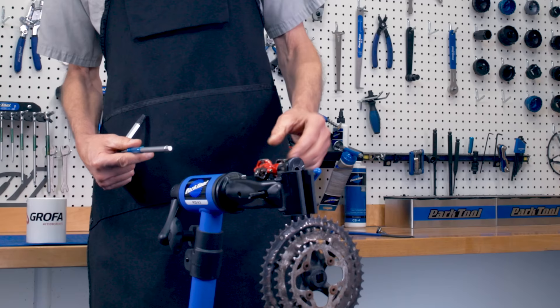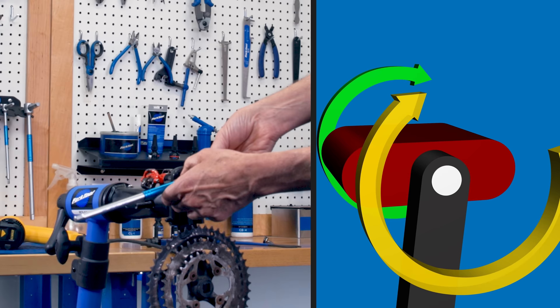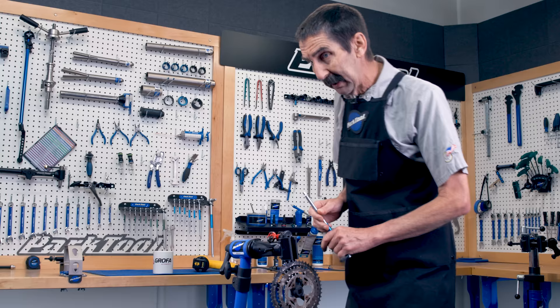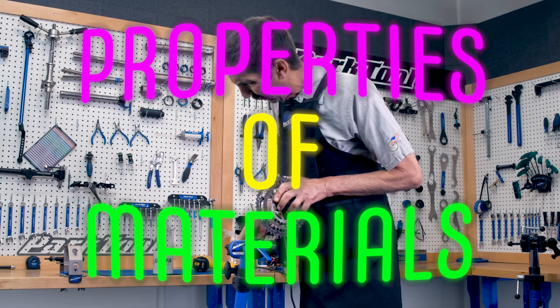Let's talk about direction of turning. This is a pedal and I'm on the drive side — this is a right-hand thread. On the right side I'm going to go counterclockwise. See that motion? Counterclockwise. But the wrench is from the backside of the bolt; the wrench direction is still the same. You're seeing it — well, now isn't that turning to the right? Well, the pedal sees it to the left. This is the loosening direction. That's important. I'm actually going to flip this around so I'm pushing down — it's that direction to loosen it.